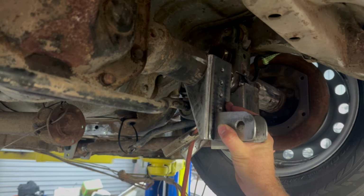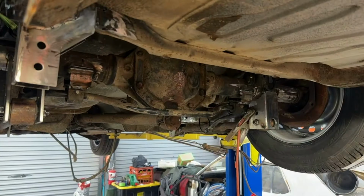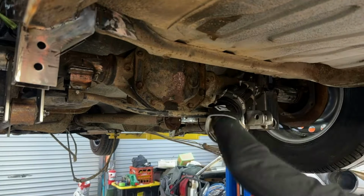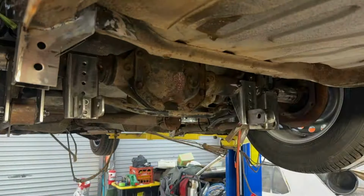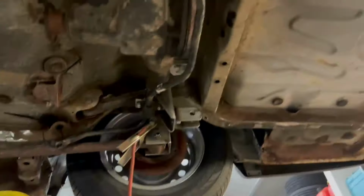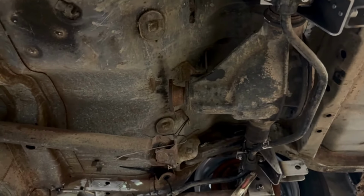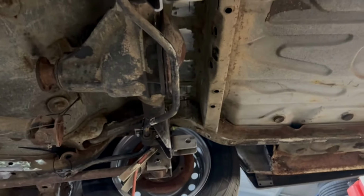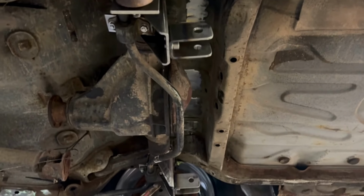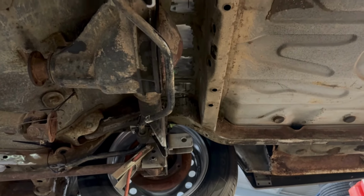Let's get these suckers welded on. Coilover lower mounts, or diff mounts, tacked into place. I'm not sure if this relays, but this is what I was trying to say before. That pinion angle there, which might be deceiving, is 0 degrees. And the coilover mounts, as you can see, point back a little bit. They are even. And depending how you measure it, they are 4 or -4 degrees.